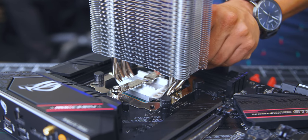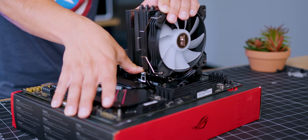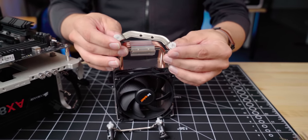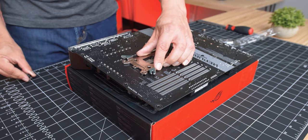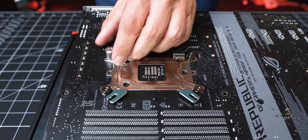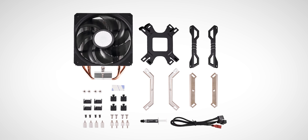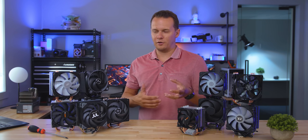The MT6S uses a pretty easy but completely insecure plastic mounting clip system that's really wonky. The Be Quiet Pure Rock Slim 2 fails in the security department because it uses a push pin installation for Intel — and that's a lot of weight to be hanging off of just a regular push pin. The 212 Evo uses an old installation kit with a massive kit of tiny parts, but Cooler Master has gradually improved that with new revisions, so I'd recommend going to one of those instead if you want less pain during installation.